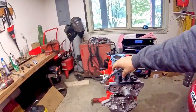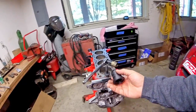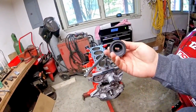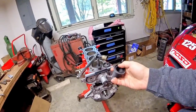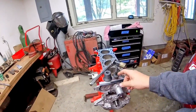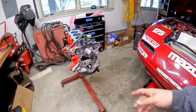I'm excited to show everybody how the new Flying Miata V2 crank tools work. If you watched my previous videos, you would have seen me using a machined aluminum piece for some of these oil seals around the engine block. They've now got a V2. It's light, looks maybe 3D printed out of something much more durable than standard PLA, and it still has that same machined lip. All that we need to put this seal on is the seal, the crank bolt, the tool, and of course just a ratchet to run it on. I'm going to oil the seal, put it on, and then show you how the tool works.